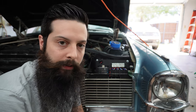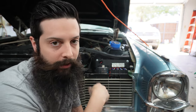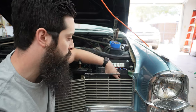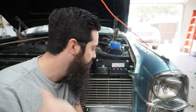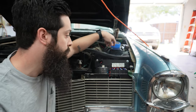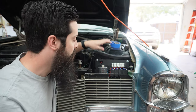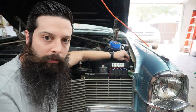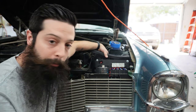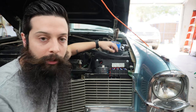Admittedly, it's been a couple of days — life happens. But let me show you where this ended up because I think it looks really good. There are two cavities in the front of the Cadillac — one here and one on the other side where the battery is. There were a couple of relays in this spot already, one for the horn and one for the transmission stator, so I'm putting those back in a slightly different spot. This is all mounted up on standoffs so I can run wires behind or loop them through, and this hole lines up with the original hole already in the body to run the wires through.